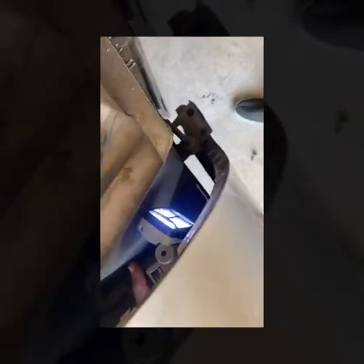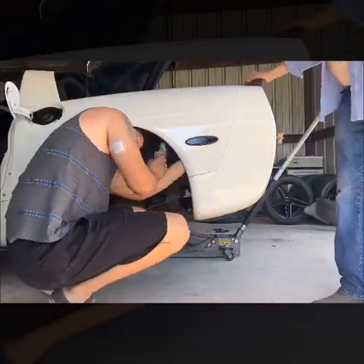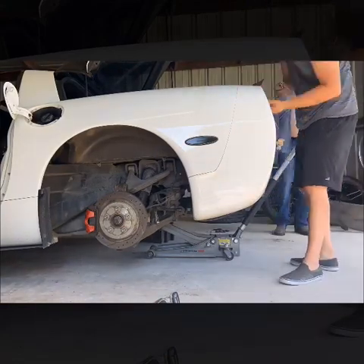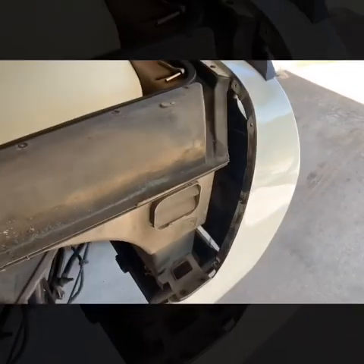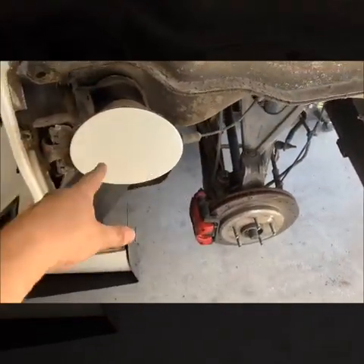The fender is still not completely off, but the remaining bolts still need to be removed. They're right here — the fender stayed sealed up against the bumper. You come around to the side; there are two or three there, and then the other two on the top that you access through the tail light.